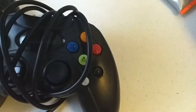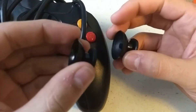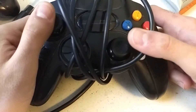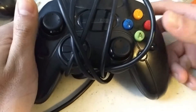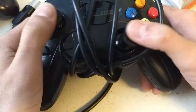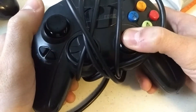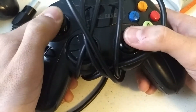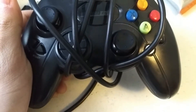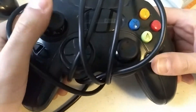The sticks actually fit just fine. I took a look and they are exactly the same size — the only difference is the way they are inserted into the controller. The sticks turned all directions just fine. The only thing I don't like is that pressing down on the stick — that extra button — is kind of difficult now. You don't get the same feedback, you don't get that nice click, especially on the left stick. I think my mistake was not wiggling it around a little bit after about half a day and pressing down on it, just to make sure the glue wasn't preventing that.